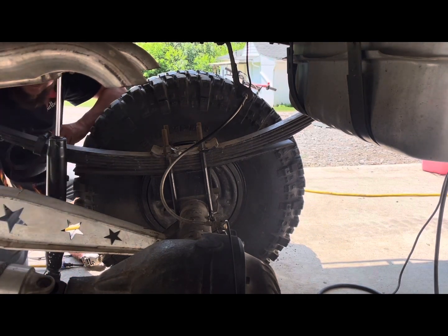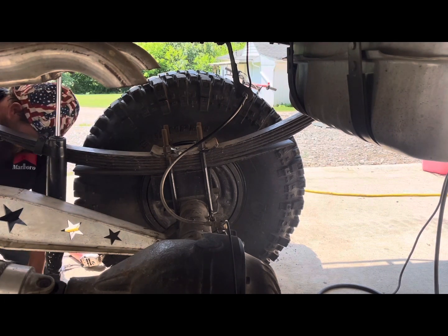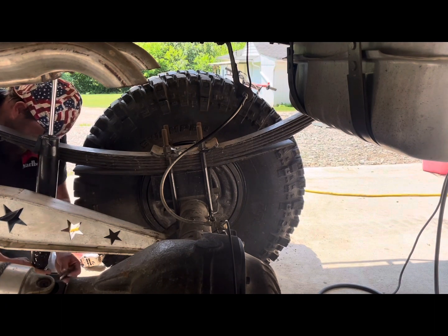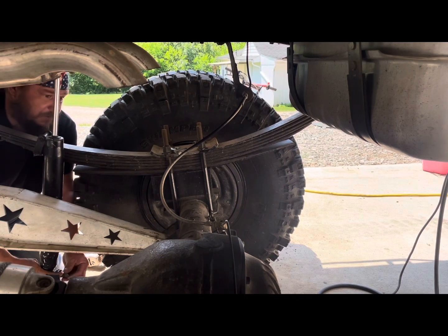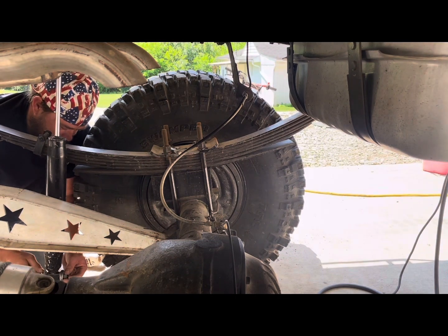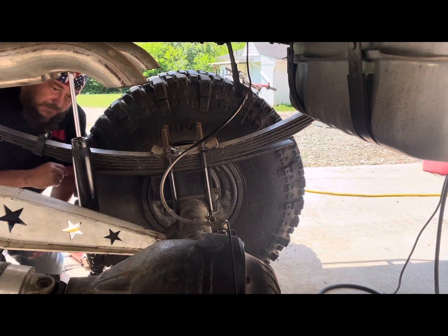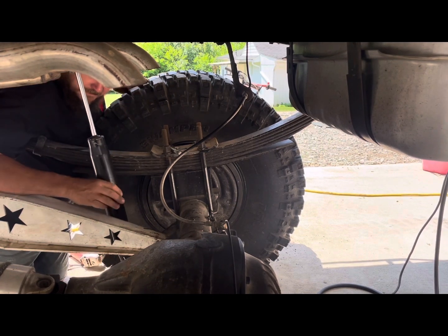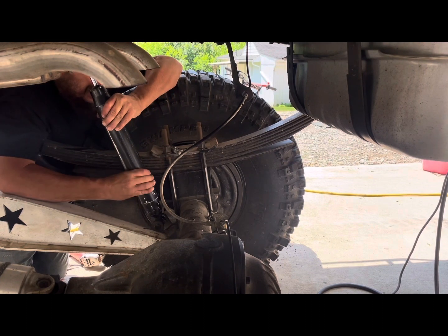Oh, what's the best way to do this? I'm gonna put washers between it because I know it'll shrink. But it always shrinks up on you. Then you can't get your shock out. I'm gonna use lock nuts so I won't lose them. So I don't have to. I recommend using nylon locking nuts on as many things as you can.